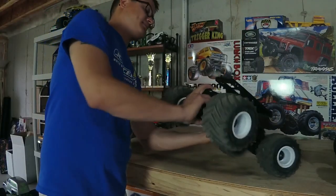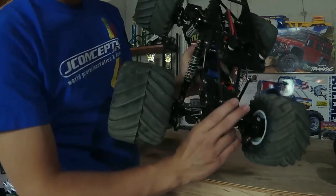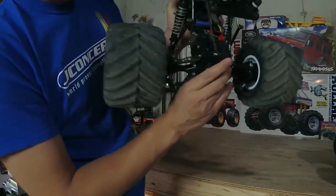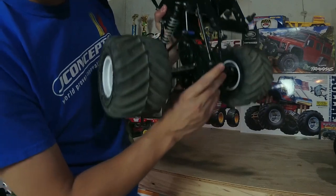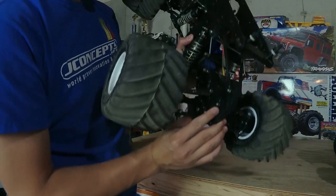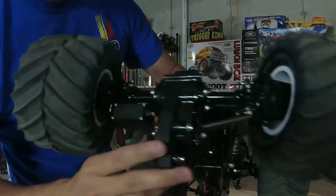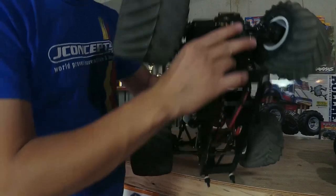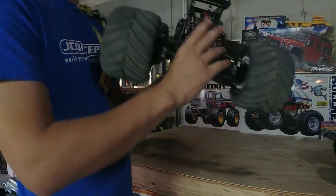The front and rear — how you have to mount them up with the four links — Sutton Motorsports actually makes this mount here. It's Delrin, an adjustable four-link mount. You run it over the chassis, the gear case is there front and rear, and it allows for customization. They're super strong, so you can change your link angles.